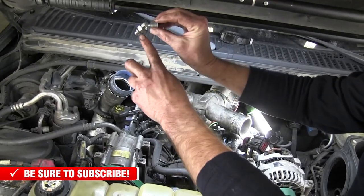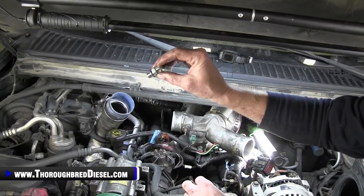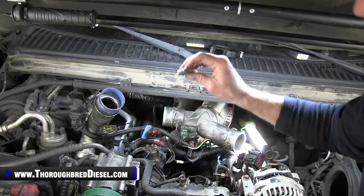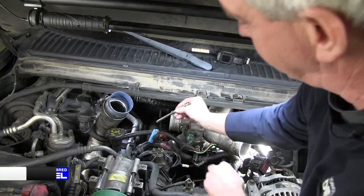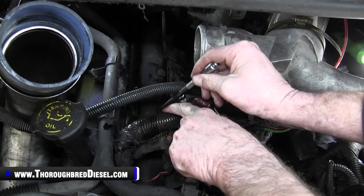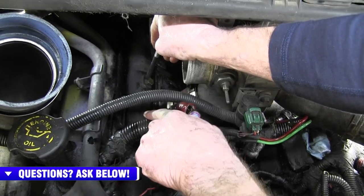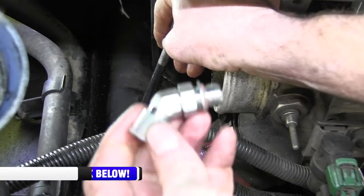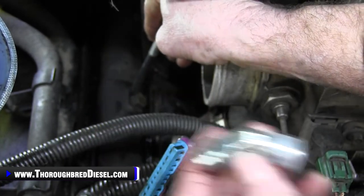The fitting goes into the head with the O-ring portion going in first — that's your sealing side. Run your nut up away from it so you can tighten down on the O-ring well, then simply tighten the nut down onto it. The balance line plug is right here underneath this wiring harness. We're going to remove that plug from the head and put another fitting — also numbered number five — in O-ring side first, angled appropriately for our crossover line.